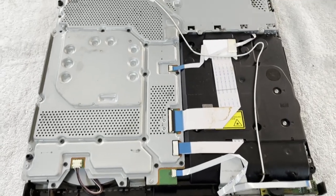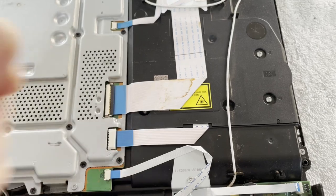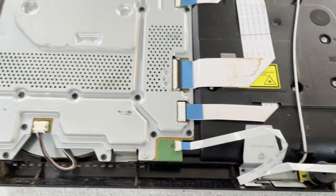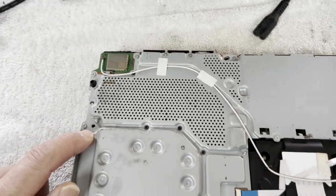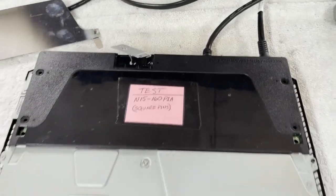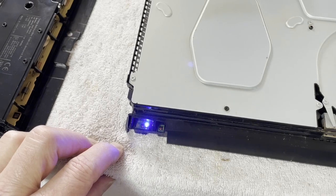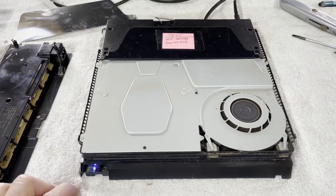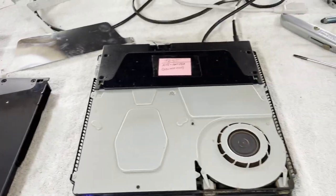I've got the bottom cover off and it looks reasonably clean, it's dusty as everything, but I don't see any signs of roaches — that's good. It looks almost like liquid damage right in there, and that ribbon cable is not the original, it's off of something else. The bottom screw retaining the power supply has been removed, so someone has tried a supply already. I have a spare supply in there, let's see if she acts any different. Yeah, we're staying on. So did somebody try a supply or not? I've got the hard drive out so she's not going to boot up, but we need to clean up a lot of dirt and fix the power supply.